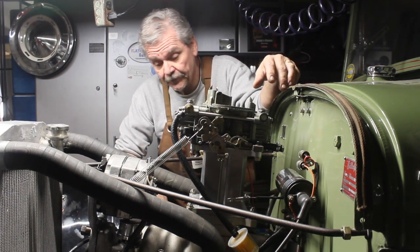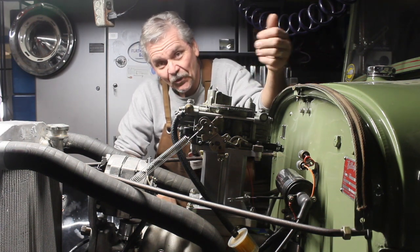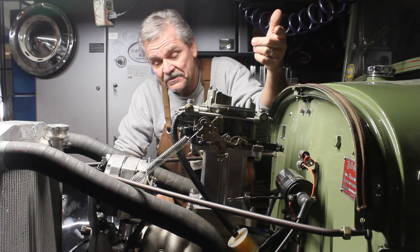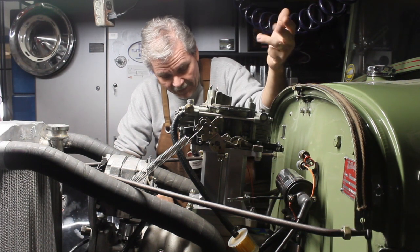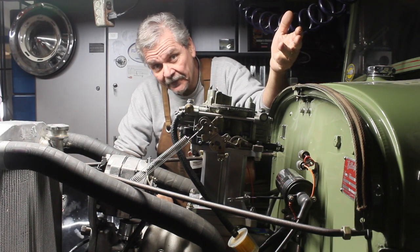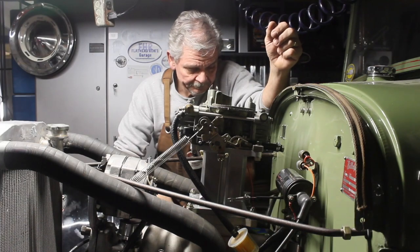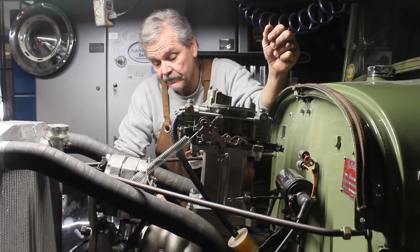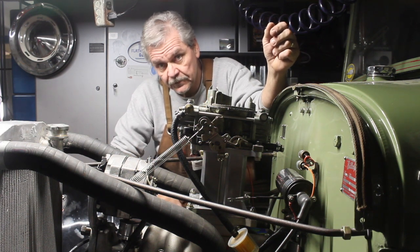It gives me a chance to clean her up. So right now we're looking at a set of rod bearings, a complete gasket set, a new starter, shaft's bent, and the Bendix tooth is chipped. So that's all I have to say about that noise. And while I got the motor out, I'll probably put a different steering box in it.